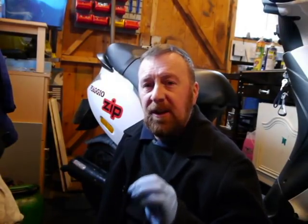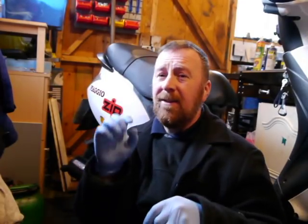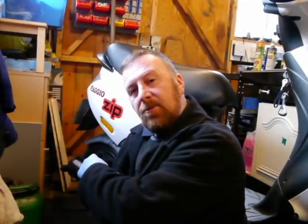Top tip in cold weather: start your bike and let it warm up just a little - don't burn your hands - just so the engine warms up and the exhaust heats up slightly. Turn it off, then spray your penetrating spray, your WD-40, your maintenance spray on the two nuts. You do not want to snap them - snapping is bad, believe me. If you snap them and try to drill them out, you drill left, right, up, around - it's an alloy head and you never seem to get the screw properly, then it doesn't tighten back up and you've changed the head. Don't snap them - take them off nice and gently.